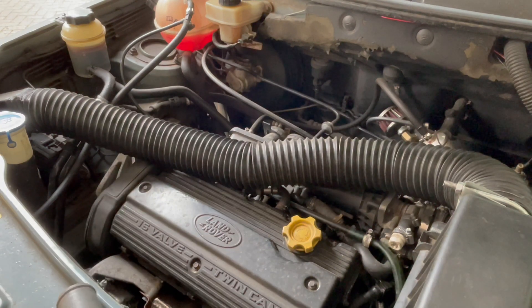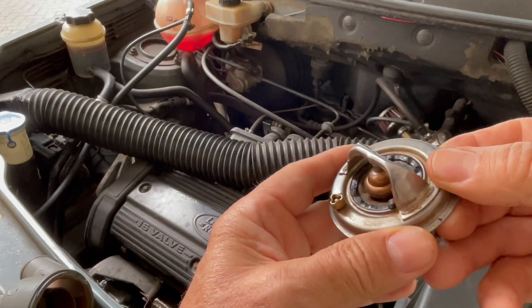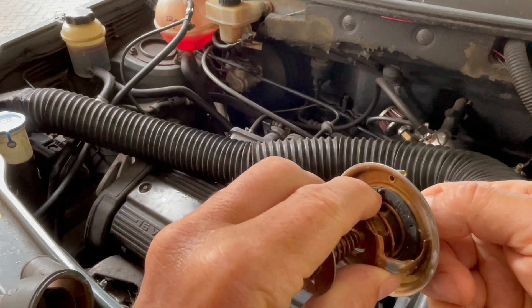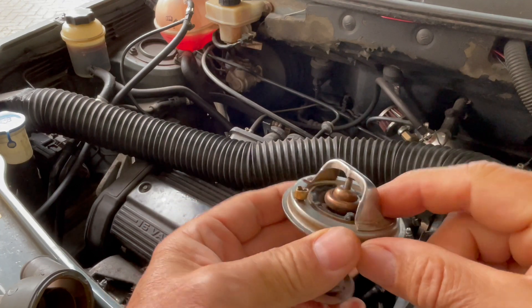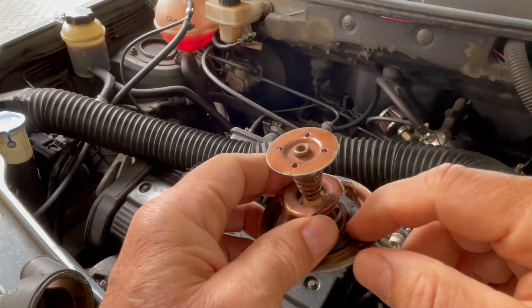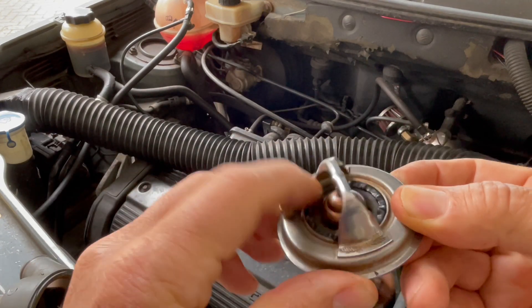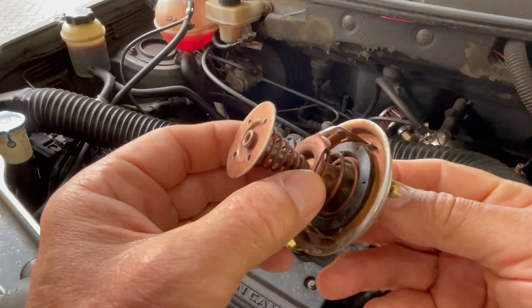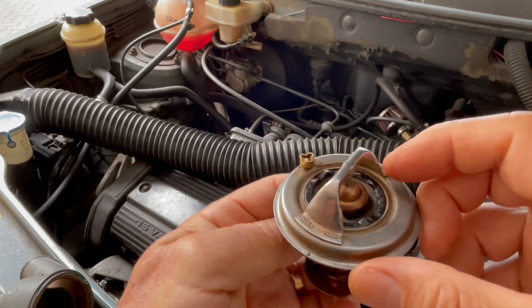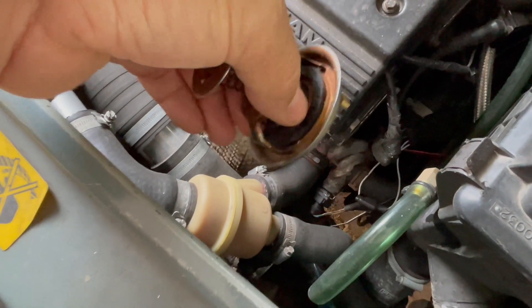Maybe not every car overheats — it's probably made worse with age. I suspect Land Rover or Rover were aware of this issue, which is why they put a rubber sealing band around the joint on the plate where the thermostat opens and closes. That would normally give a better seal so no cold water leaks through. But you can see the rubber with age has wrinkled up a little bit, and when I was getting this issue I actually swapped from the grey thermostat to the beige one — that's the new configuration we'll come to in a minute.